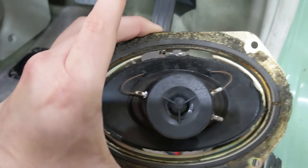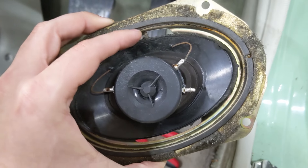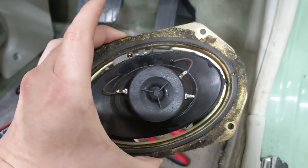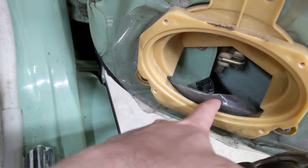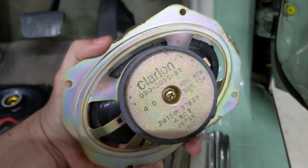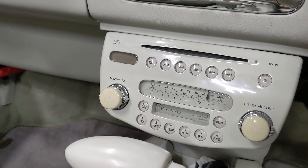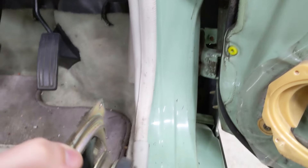The original one is very blown, as you can see. The surround is completely gone — it's dead. I tested it with an ohmmeter and it read open, so this was dead. I also tested to see if I could get any AC on that, and something was there, so hopefully the amplifier is fine. I'm pretty certain this is the original speaker, because I believe Clarion made the stereo for the Figaro. So this is probably an original speaker.